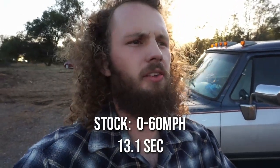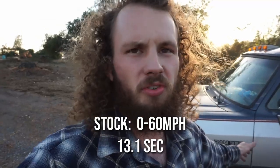So, if you haven't guessed the 0 to 60 time yet, feel free to take a guess. You might win some Super Clean. Again, the factory time was 13.1. That's with a bone stock truck, except an NV4500 transmission from the second gen. Other than that, engine-wise, bone stock. Right now, we have fuel pin, 3200 GovSpring, HX35 turbo, fixed boost leaks. We will have the timing advanced on the injection pump by the time we do our 0-60, but again, now we're putting out 30 pounds of boost, and this is a different truck. 13.1 stock, what is it gonna be upgraded? Let's hear it. All right, thanks guys so much for watching. We'll catch you on the next one.